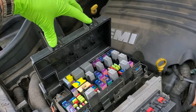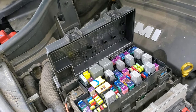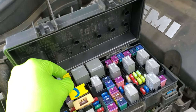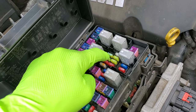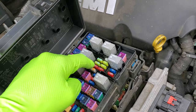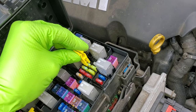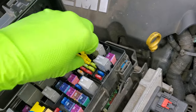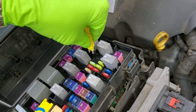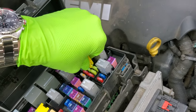Now we're going to open this up here. More fuses. There is a fuse puller located right here. These two fuses both provide power to your daytime running light relay. The top one provides power to the relays at all times. The one underneath it provides power to those relays only when the car is on.